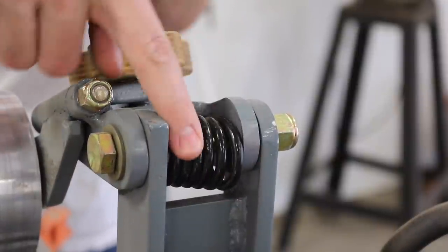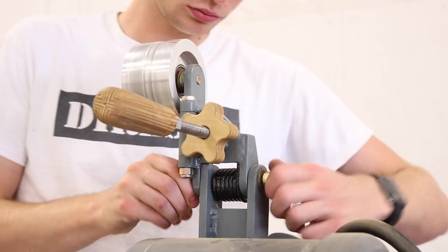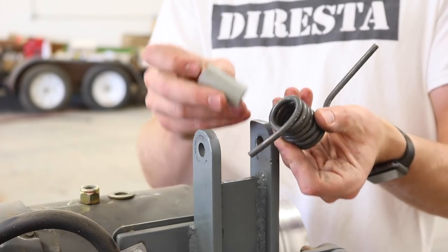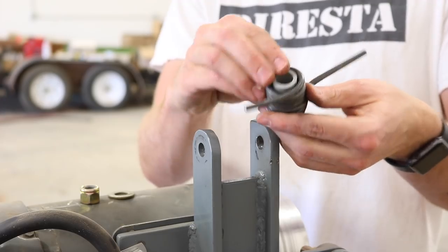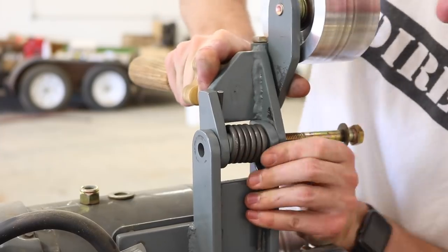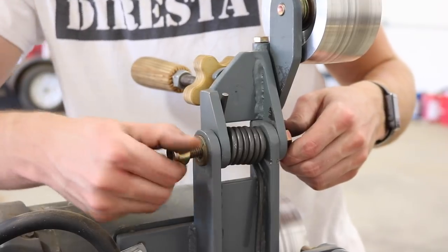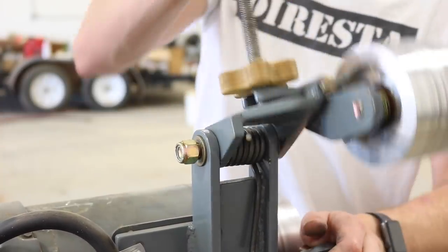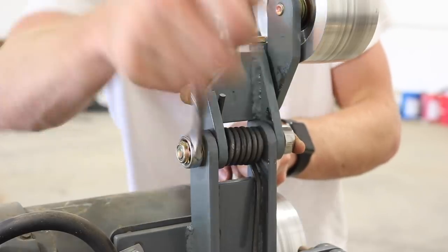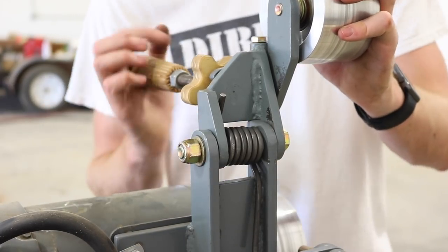See how this spring is all lopsided? Remember that. Now I'm going to disassemble the whole hinge and put the new spring in. To keep the new spring from collapsing I'm just going to put a little piece of half-inch PVC conduit in it — and that feels like about the same amount of spring tension, so awesome. You don't want to tighten this bolt — just thread it on far enough that the nylon is holding it so it won't fall off.